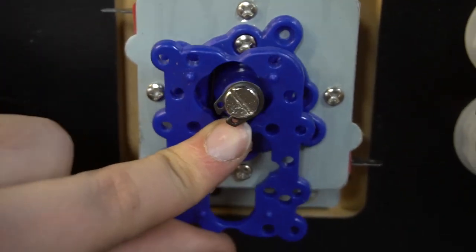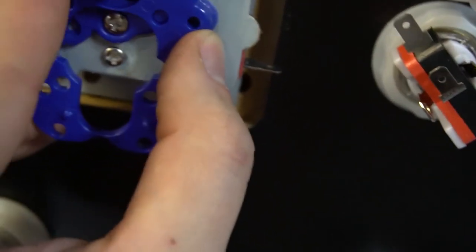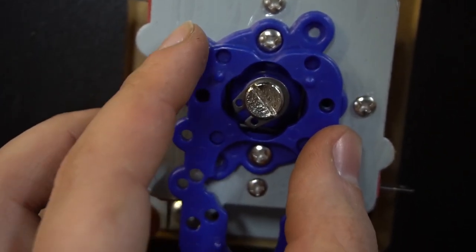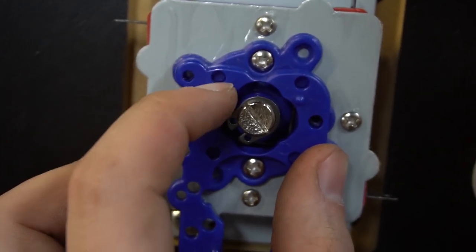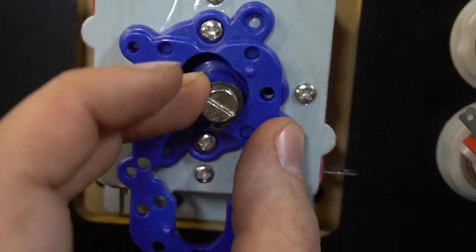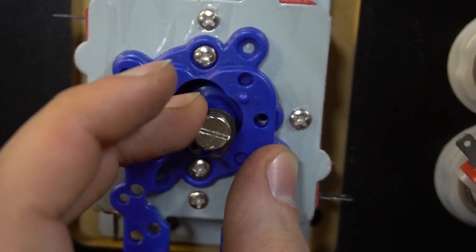Now, if I bring it down to the four way, sorry, gonna do this with one hand. I should put down the screws. If we line up the grooves now, look at that, four way. See that? Right where my finger is, that groove right there is gonna block out going diagonal, making Pac-Man work perfectly. Pac-Man will work beautiful on a four-way joystick. Again, with that little groove, see this? It won't really click. It's not gonna click the button.